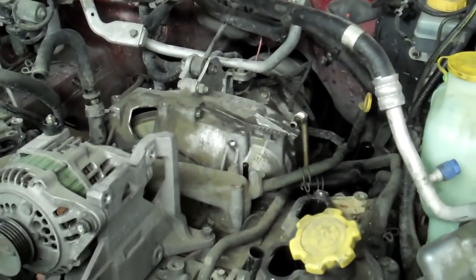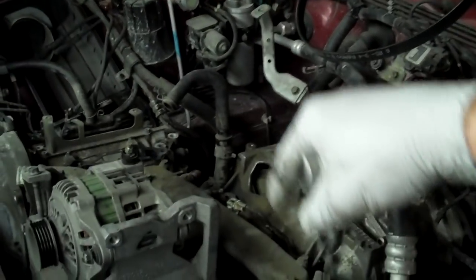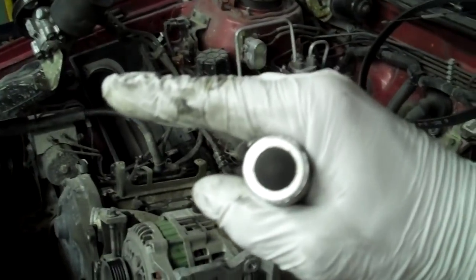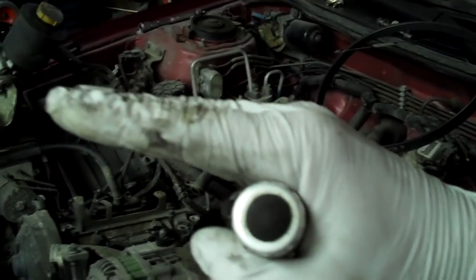So here's an example of what I was showing you earlier. See, I have 3 jack stands, 2 to support the vehicle by the unibody. The other one holds the transmission up, so I can clear the studs on the motor mounts. And then the radiator, the reason why I pull that out is, see how long those bottom 2 studs are? They're really long. In order to clear those and get the motor out, you're going to use the room where the radiator was, of course, for the flex plate to the torque converter. But you pick the engine up, and the engine and the transmission both go up like this, and that clears those studs on each side for the motor mounts. Once it's up like that, you put jack stands underneath the transmission so that it stays up at an angle, and then you pull it forward, and then it comes up and out the rest of the way.